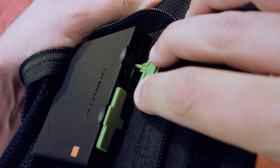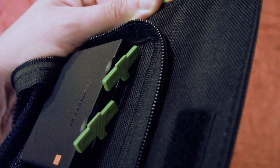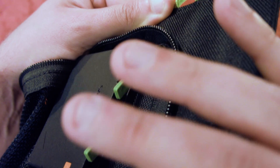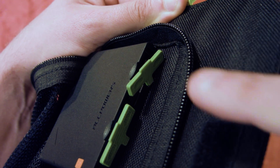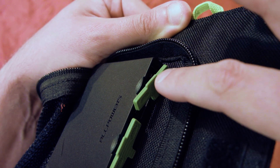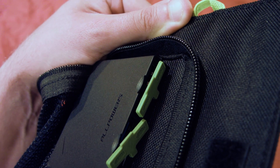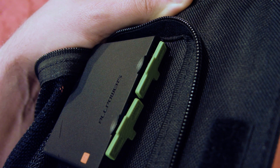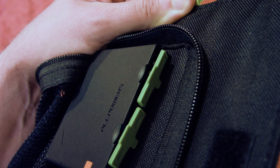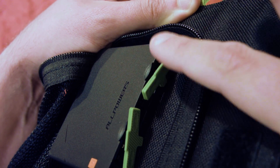It has rubber covers over two ports. One is a 1-amp port and the other is a 2.4-amp port. Some devices are 2-amp, some are 1-amp — you're not going to hurt anything by plugging into the wrong one. But if you have a 2-amp device like an iPad, the fastest charge time is achieved with the 2.4-amp port. If you plug it into the 1-amp, it'll charge a lot slower — you may even see a message saying you're slow charging. If you have 1-amp devices, plugging into either is fine.